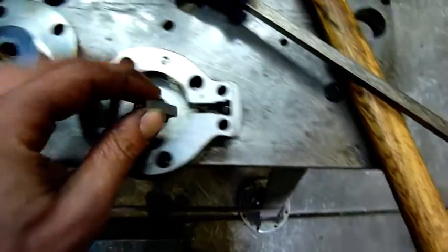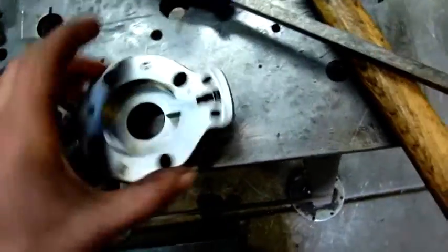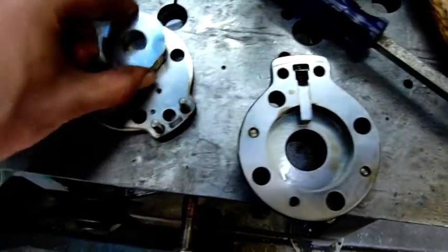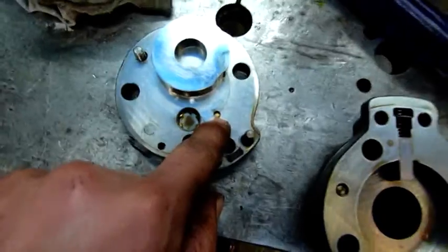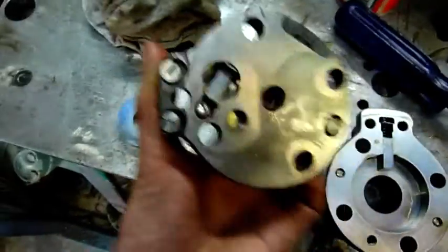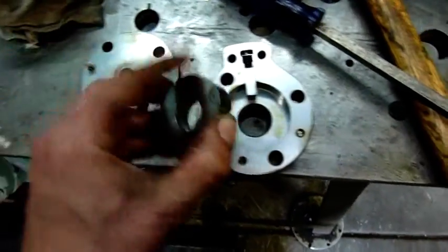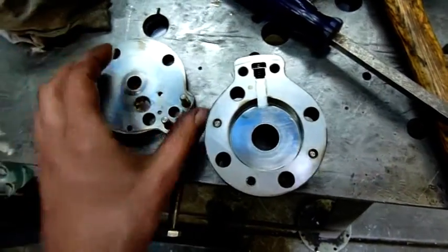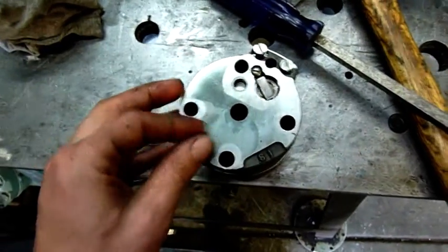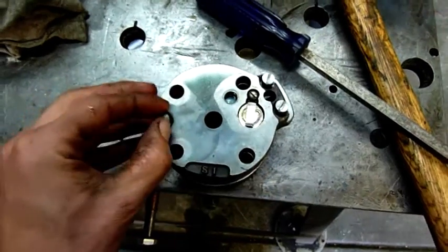Very precise piece of equipment. The pump's fine — it's just the motor that gave out. That's all there is to it: the vane, the rotor, and that's the discharge side there — that little hole. There's the discharge reed valve on the other side. It goes to the housing of the compressor, and the suction comes up from underneath on that little round block on the underside. All of this can actually go back together again as a working unit, assuming I can get the screws in the holes.